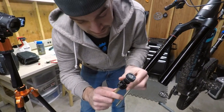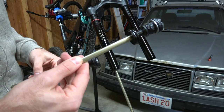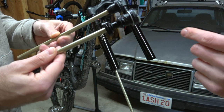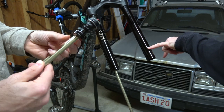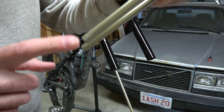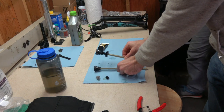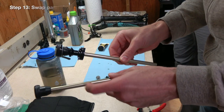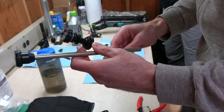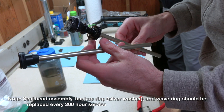Look at that. Smells terrible. This is the shaft that we're going to be replacing — this is the old shaft. And that's the spring that was pushing a little bit when we were moving it up and down. There's a groove that sits inside in the lower stanchion and that pushes against it. As you can see, it's just a little longer here — we're going from 150 to 160. So we've got the old and we've got the new. Normally you shouldn't reuse your crush washer and should replace a lot of things, but since I'm a newbie we're just going to put it back together and it should be fine.